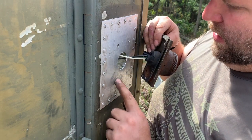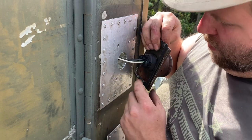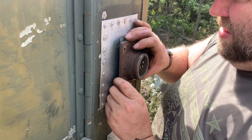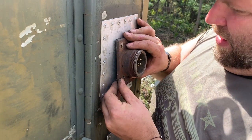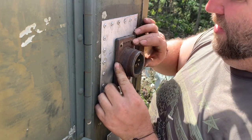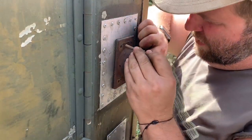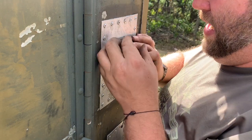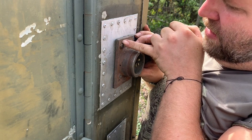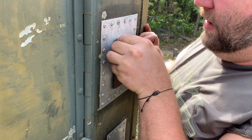When I took this off, this was all wet down here. I mean, it wasn't here, it was down where it was originally, but this portion was all wet and this was corroded back here. I couldn't figure out why. I was like, what the hell's going on? And I said to myself, well, where can the water be coming in? And then realized that it was coming in these four bolt holes. It was weeping in through capillary action. This lettering here was keeping the bolt out a little bit, keeping it cockeyed in there.